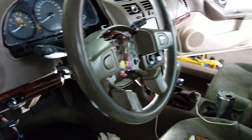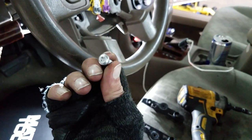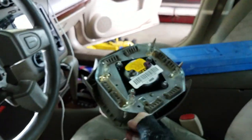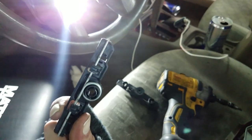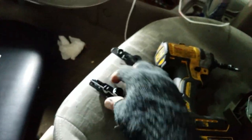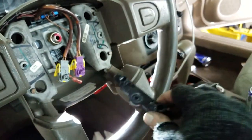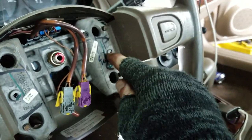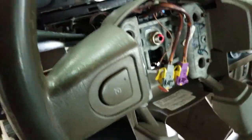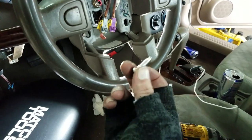All right, so I have now lied twice to you. The hex screws, these guys, didn't actually hold this in. It was simply just the release bars. Now, how this works is, here are the release bars. See how they bend one way, right? Okay, these mount just inside here underneath this, back in there, like that. And the screws hold those in place. And there's threading right here, which holds this backing to the release bars to the center column. So yeah, these actually have nothing to do with anything, and by pulling them out, I probably made it a little bit more difficult.